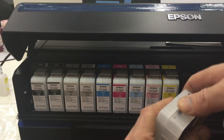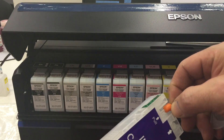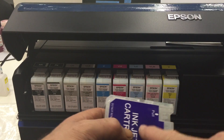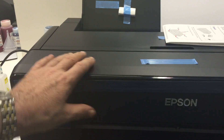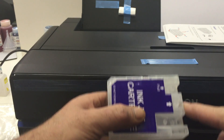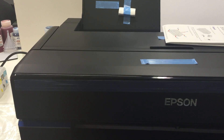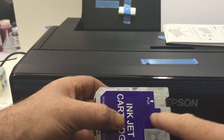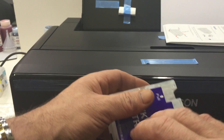Very important. It's not so much that you want the air out of the cartridge, because this is a pressurized cartridge. You'll be removing this orange plug over the nipple of the cartridge for the air port. What's more important is to get all of the air out of the pipeline that leads to the valve. I want nothing but ink coming out of here, even the very first time you fill it. Words to the wise. I don't like any air in my printing system. The air that's pumped into the cartridge is going to force more ink out. But there is a pipeline inside this cartridge and without pulling this label off and showing you the pipeline, it's more complicated than you think. It doesn't just dump ink out the exit valve.